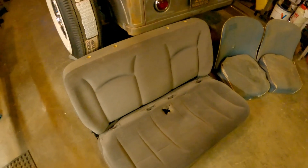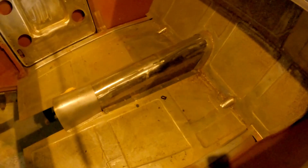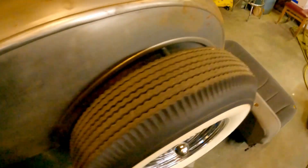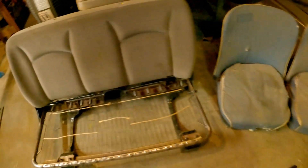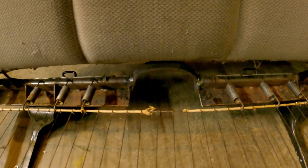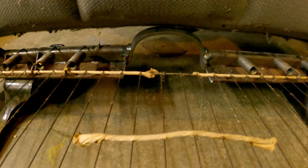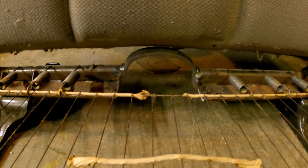That's an easy way to get a hinging seat. On mine, I actually have a tunnel in the car since the front is a Z, so I needed to clear that. I took the cover off, unbolted it, cut the section out of the middle, and welded in a piece of like quarter-inch flat bar that I just curved in the vise and welded in place.